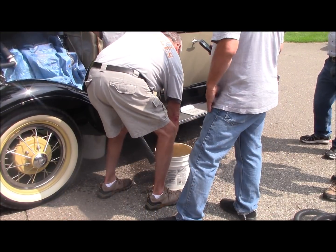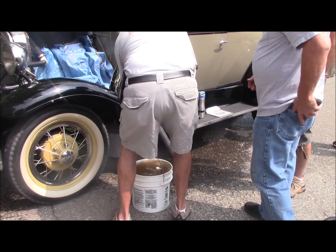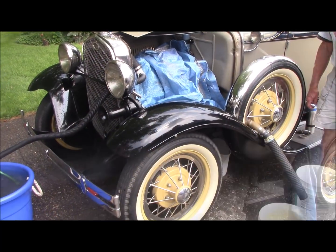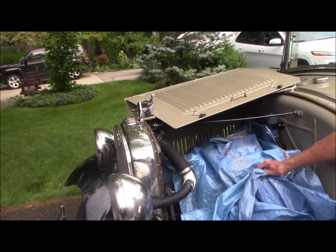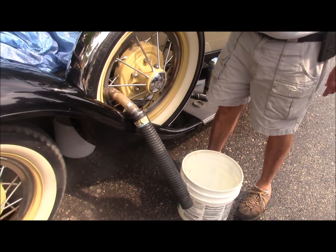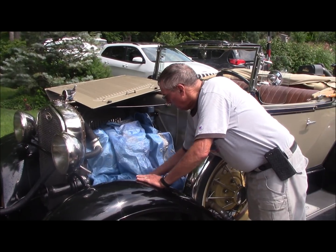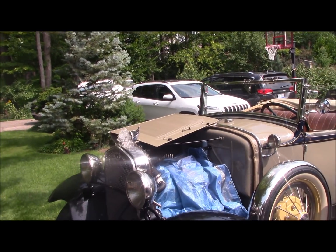We got water coming in. Look at the black stuff we got out of that radiator — clean water and dirty water. We're going to back flush this one after we run it the first time. We got 5.83 seconds that time. We've got a 10-gallon bucket with a sump pump feeding into the top radiator hose, and we catch the water out through the bottom. It's not a recirculating system, but it's plenty enough water for us to do our job. We know this guy's plugged — we ran it at 15.4 gallons a minute. She's bubbling out the top, which means we have a constant pressure.